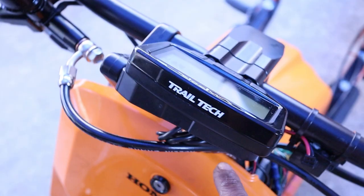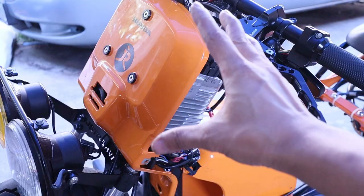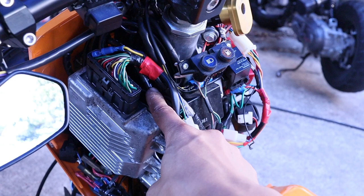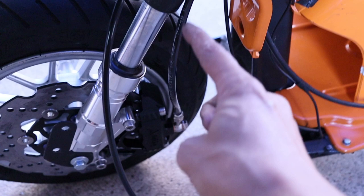Then the wire goes in, the hose goes in, and my goodness, the kit that I got, the hose was almost 4 feet long. So imagine from here to here, it's only about what, 2-3 feet maybe? I had to wind up very stiff hydraulic hosing behind my battery. You can kind of see it here. Without notching it or bending it too much, you understand steel braided line is not very easy to bend. So then it comes out here and goes into the caliper, which leads me to my next subject.